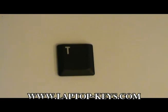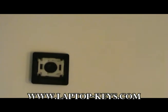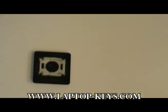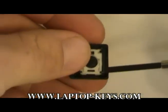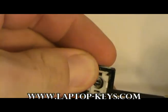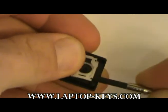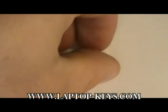If you do, the keycap must be removed from the clip in order for the parts to be installed. If you only receive the clip hardware, you may skip this section. As you observe the back of the key, you will see the clip is attached to the back of the key. You will need to remove the clip using a small tool — in this example, a precision screwdriver. Get between the clip and the back of the key and gently pry them apart. After you have removed the pieces, it will look something like this.